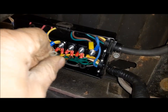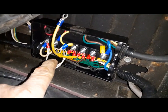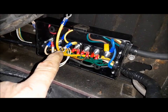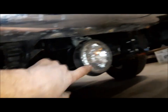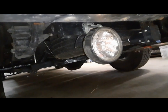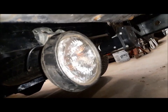Just inside the back bumper on the bottom of the box on one of the little cross members, I've mounted a junction box. This is the wire coming from the front, this is the wire going down to our seven-pole plug, and this is the original wire feeding the light part. The brakes and auxiliary power come from the front through the new wire. I've also got a yellow wire, which we commonly use for backup lights on the trailer — we'll control them by a switch, not letting the reverse light switch in the truck control them. I put a couple of hitch lights under the back bumper, just the old rubber ones that were really popular on older trucks.